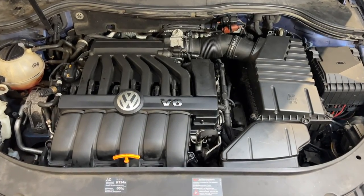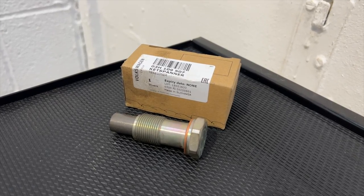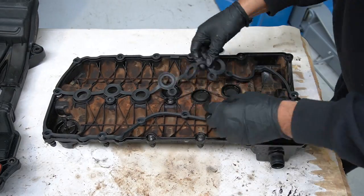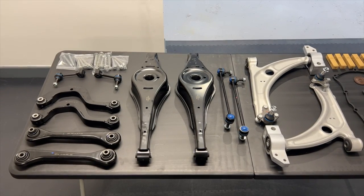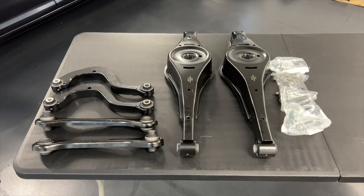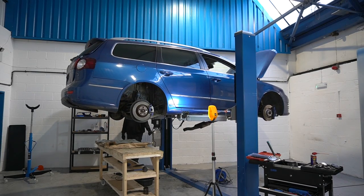There's not really much you can do with a naturally aspirated VR6 anyway unless you're spending five figures on a turbo kit, but we'll revisit that in the future. In the intro video I gave the car an oil change and tried remedying the chain rattle it has on a cold start with a new upper tensioner — this actually ended up making it worse, so I threw the old one back in until we do the complete timing chain job. In the previous restoration part one video I addressed the oil leak with a new rocker cover gasket and chucked in a new set of spark plugs. There were also a bunch of suspension arms from eBay — the goal was to tighten up the car as most of the bushes were looking pretty tired and were advisories on the prior MOT. I fitted most of the front components but postponed the rear items due to quite a bit of surface rust on the subframe and chassis. With this being a restoration project, it wouldn't make sense to do a half measure.